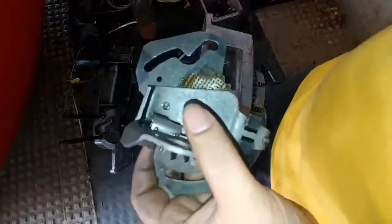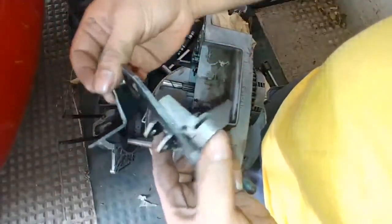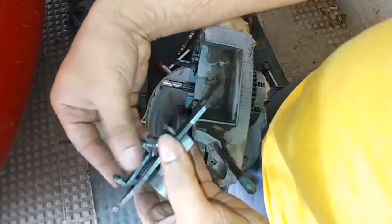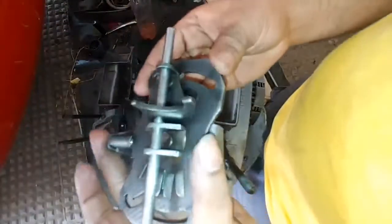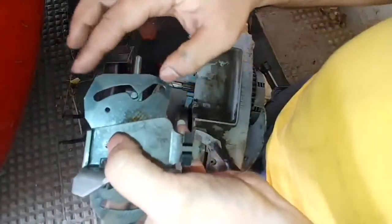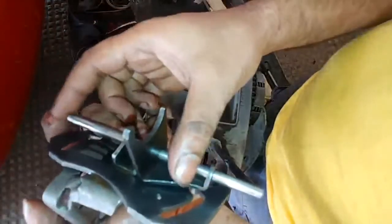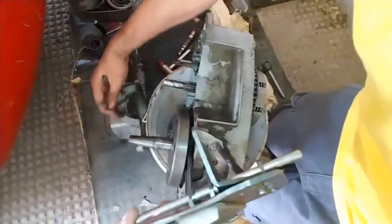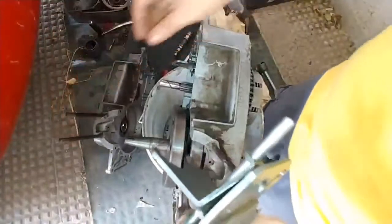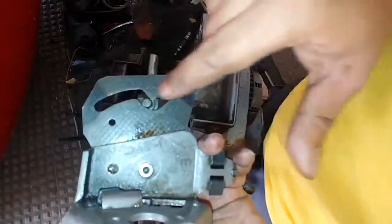The next part is the fork. One fork sits in this groove and another fork sits in this groove, with a guide rod going through them. For now we'll look at just one fork. When the cam plate moves, the position of the fork is fixed — this guide rod keeps it in position. One end of the guide rod goes into the left engine case and the other into the right engine case. These forks remain in one place; only the cam plate moves in relation to the fork.